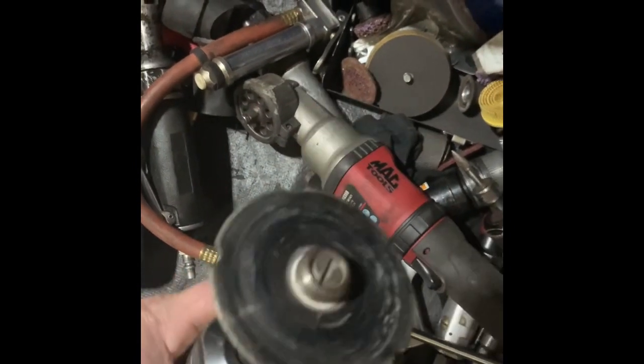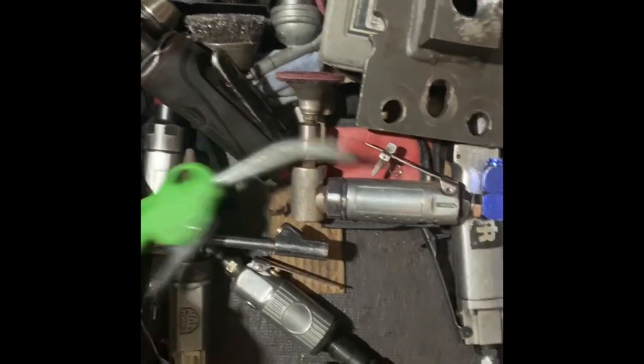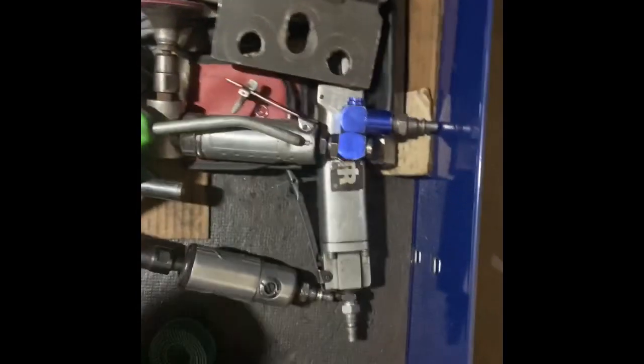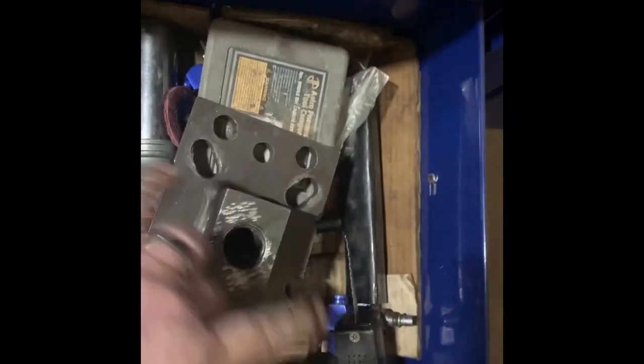The Sunex HD with the, what is it, 1 horsepower or something? Ridiculous. Right angle air drill, die grinder, quarter inch die grinder, air blower, hub prep tool. You doing brakes? Get one of these. Just clean them, guys. Not a big deal. Ingersoll air saw, way more handy than you would actually think in automotive. OTC axle popper, bolt that onto your wheel studs, put this bolt in there and push.